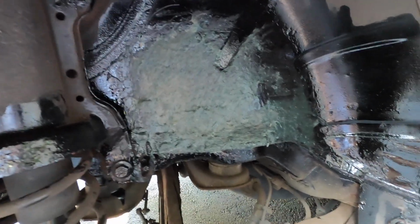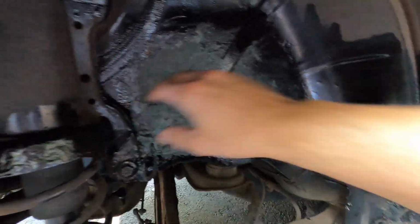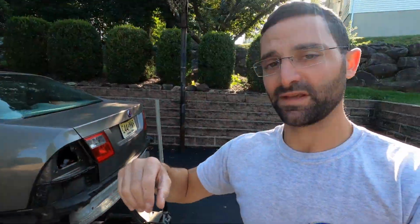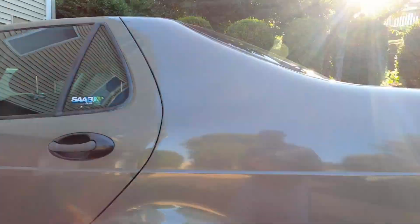So some of you guys may say that this isn't the proper repair work, you have to cut out some of this old metal, but to be fair, it wasn't rusted all the way through on all of it. It was just maybe 1 or 2 areas. So fiberglass should do the trick just to seal it off. Of course, we put the POR 15 on there before we did the fiberglass, so all of the metal that was bare and rusting has been sealed off with the POR.